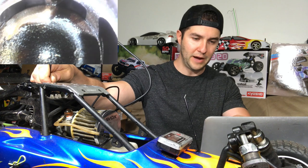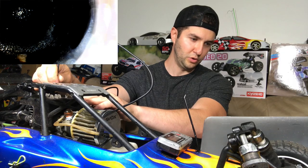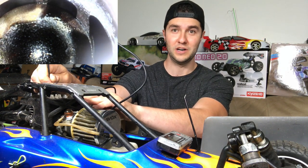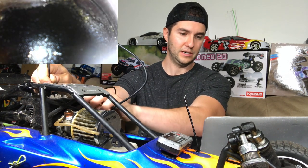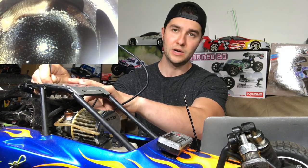So this port in the back is the exhaust port — the largest port in the back — it goes straight to your exhaust. I can see a good amount of oil film around the wall of the engine block itself. We have a couple other ports there, and I don't see any significant damage of any kind. Let me pull the pull start a little bit and we'll see what it looks like as the piston moves up. Oh yeah, look at that — you can see the film from the oil on the sides of the piston. That's what happens when you run rich, although people have demonstrated you still see this even running 50-to-1.